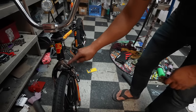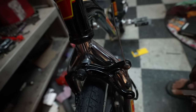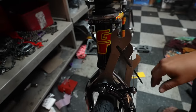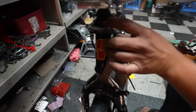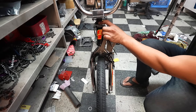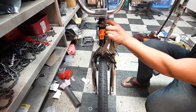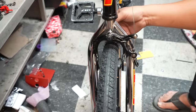Real easy, guys. If you guys look right here, this is actually a flat nut right here. All you do is put a number 13 on it and watch carefully. You gotta step back. Look — it's pulling one side. I'm going to take this and pull just a little bit. Look at that guys — notice, it's starting to pull both. Just turn that thing; you don't have to loosen any of this stuff.